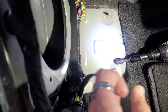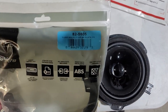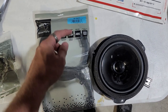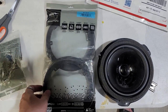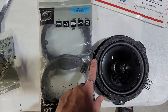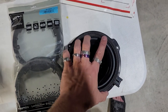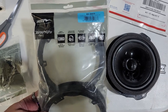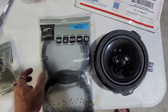This is what you're left with, and you've got your plug right here. I'm going to put some Dynamat back there so we can bolt this in. These are the speaker adapter plates you're going to use, which is an 825605 multi plate. They also make generic versions that we'll put down in the description below — there are multiple people that make these, and they all work pretty good. We're going to put these here and then use a new six-and-a-half to go into this, and we'll have to drill holes so the speaker wire can come through. We're also going to Dynamat everything to make it look nice and sound nice, so there's no rattling, and to keep it enclosed.